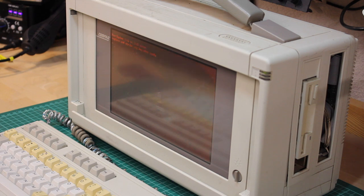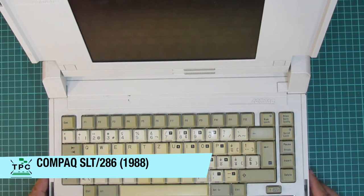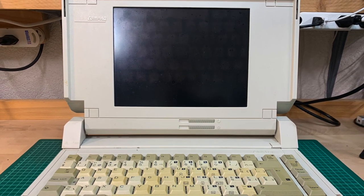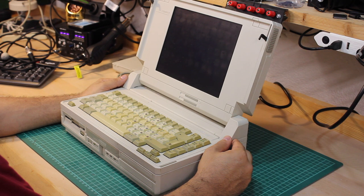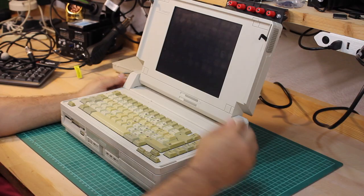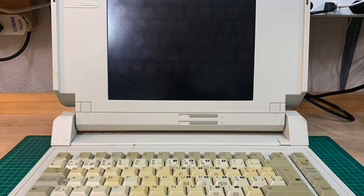There are also some missing trim panels, but this machine is definitely worth restoring — I'm really looking forward to that journey. Again a more compact machine, the SLT 286 by Compaq. This one shows some heavy wear as well and needs lots of cleaning and repair. The power brick is missing, but as I have the SLT 386, I borrowed its power supply to do a quick test. It won't really power up — there are some signs of life as an LED will quickly light up, but apart from that there's no real activity, and I will need to disassemble this one to get it back to life.